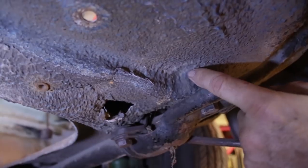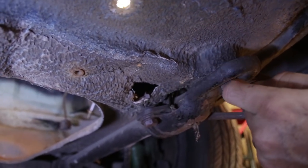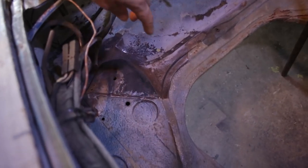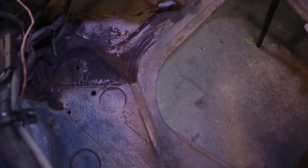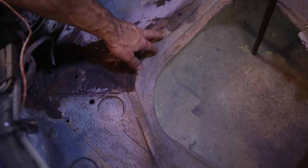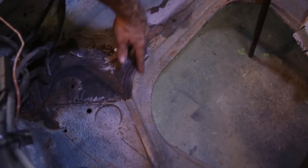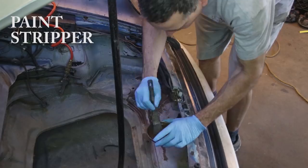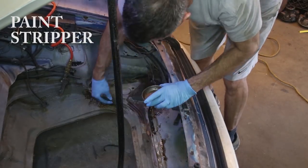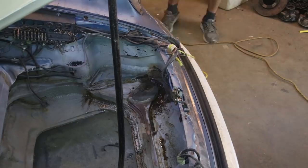It's not just patching holes — it's also getting the alignment correct. I'm going to start by deconstructing this whole area. This panel here, which creates the hollow section, I'm going to remove it from the top. It's spot welded all along its seams. So that means stripping paint and exposing spot welds. Normally you don't want this stuff in the seams, but because we're removing this panel anyways, it's fair game.